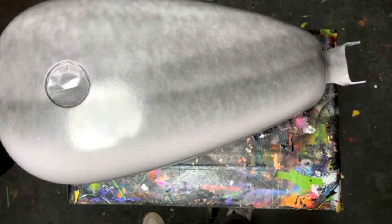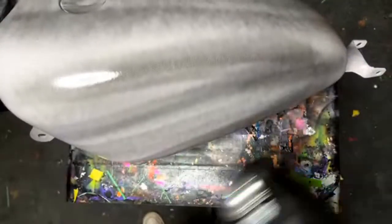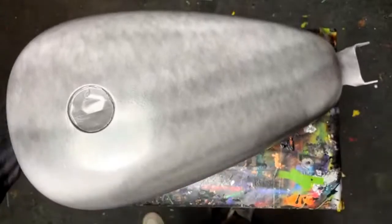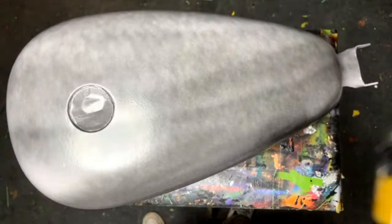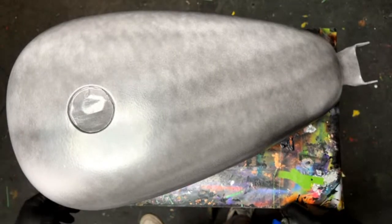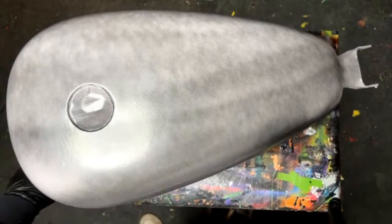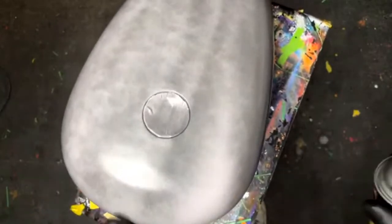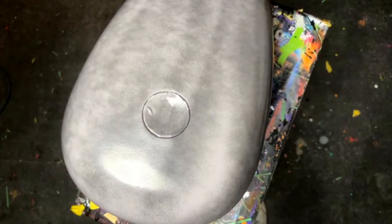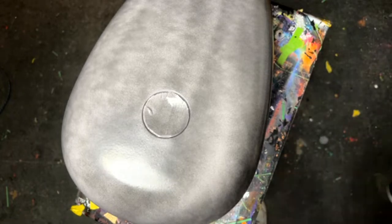Someone said, will a light coat of any black paint work? No, this is more like a talcum powder in it. It's going to cause less problems and less plugging of your sandpaper. If you didn't have anything else, black spray paint would work. Just spray it super light. Don't spray it this heavy. I do half of this because it is going to plug up your paper a little bit. This stuff sands right off. It's just like a black powder, I think it is talcum powder actually.